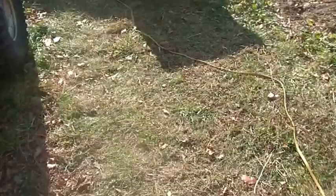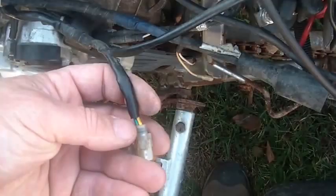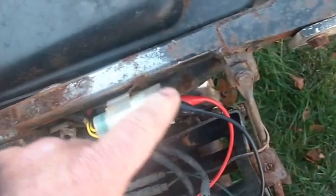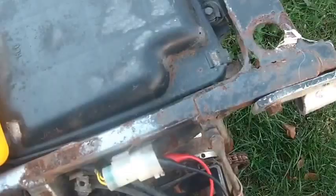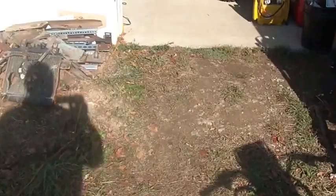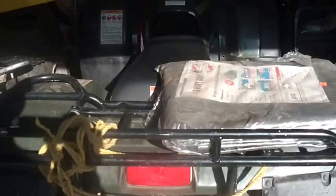Given that, it does appear as if the AC that would run reverse on this bike is open. But I get 1.4 ohms between each one of the coils - each coil to its brothers. So it appears as if this thing will charge a battery, which means I can put a DC ignition into it.